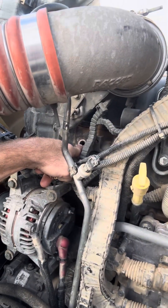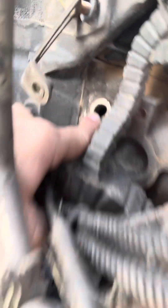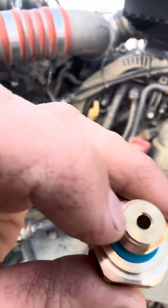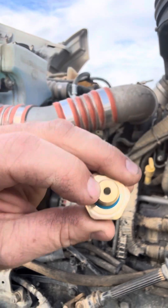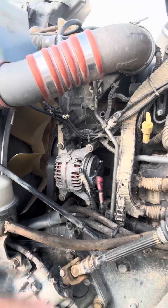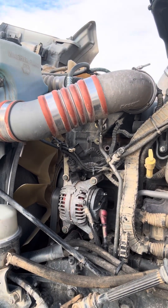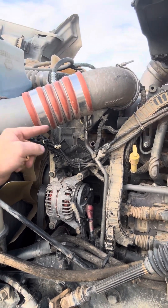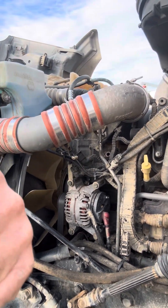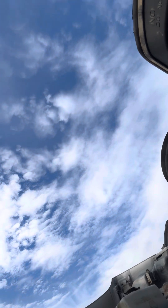You want to clean that out every now and then — like once a year or so. There's a likelihood there's a build-up of soot that'll plug up that hole right there, and you'll lose power on the truck. You can clean it out, and I usually just hit the starter, fire the truck up real quick, and it charges the system and blows out any remaining soot.